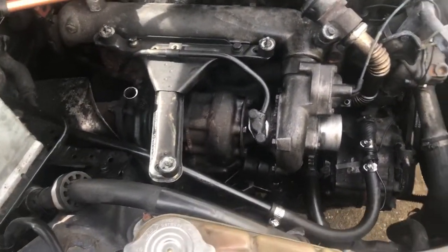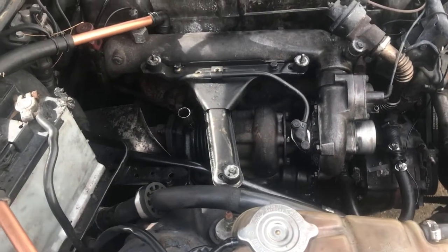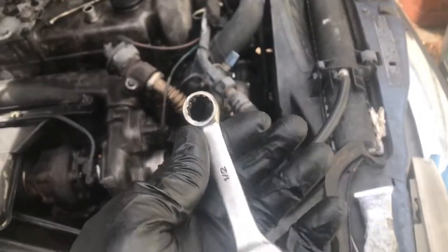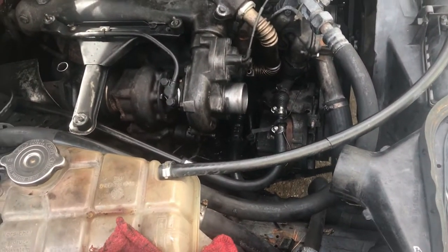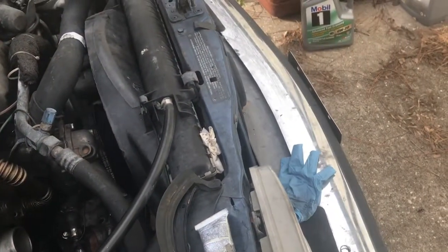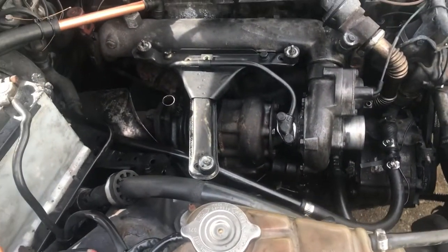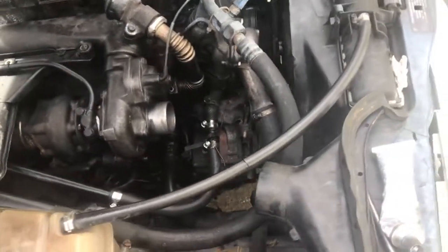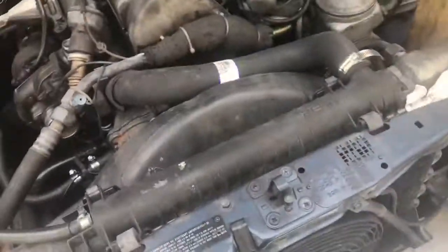And it's installed. One thing that makes this job a lot easier, well, it may be about impossible without it, is a stubby 1/2 inch or 13mm wrench. There are just places you need to get in and turn a wrench that you don't have room to swing a big wrench. So it's one thing to keep in mind. It's back together. I just have to put the air cleaner and stuff like that on it, and we're going to go modify the air intake tube so that it slips on easier without the seal rolling, and I'll show you what we're going to do there.